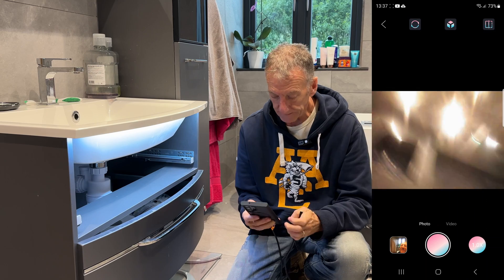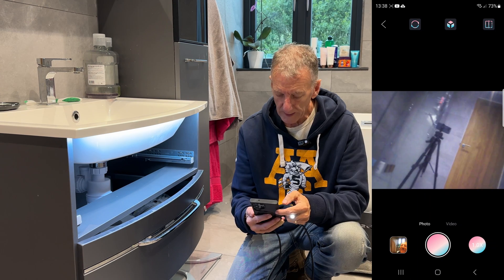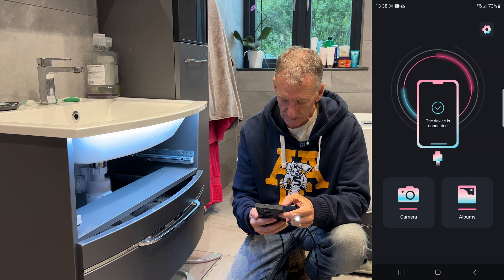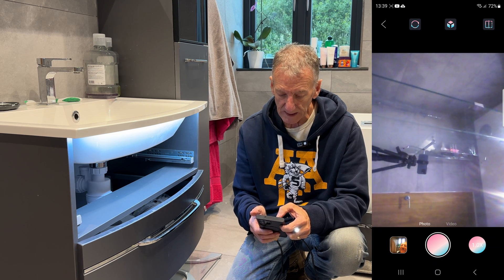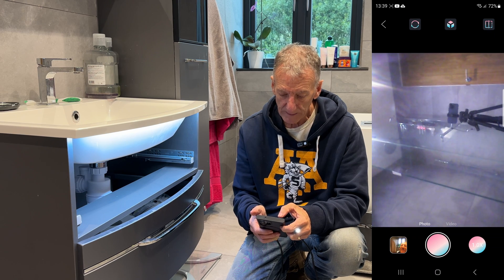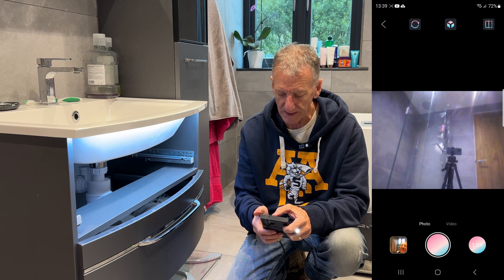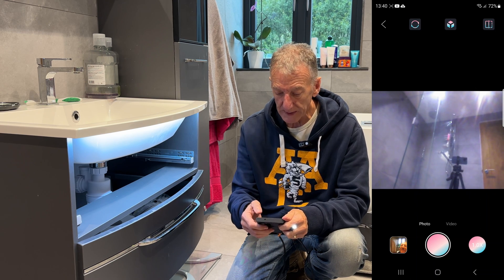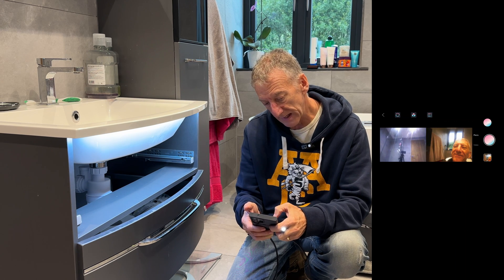To the right hand side you've got your zoom: that's at one times, press it again you're at 1.5 times, press it again that's at two times, and back to normal. Up in the top left, clicking that takes you back to the home screen. Next to the back button is the rotate button — press it and it turns to landscape, upside down, reversed, and back to normal. Next to that you've got a color button: press it and it switches to black and white; press it again and it's back to color. The button next to that lets you browse your saved files while your video is still running.